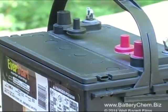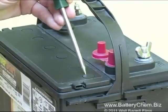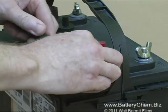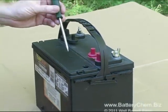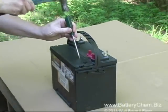As you can see, the service caps that were hidden under the decal are now exposed. We're going to take a hammer and a sharp tool called an awl and just get the awl started under the cap and simply lift it off the battery. We're going to repeat the process for all six service caps. That is an awl and a claw hammer that we're using.